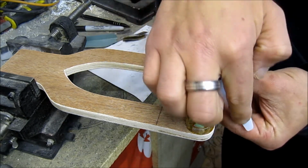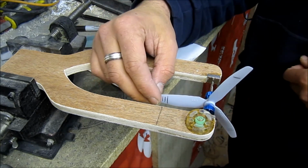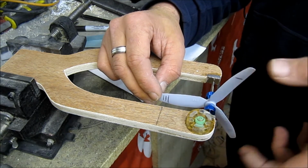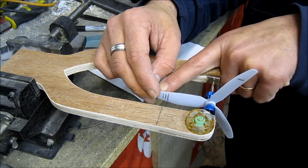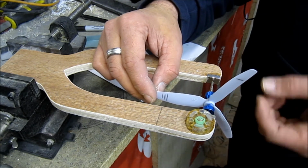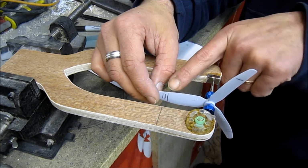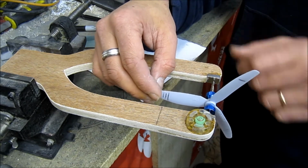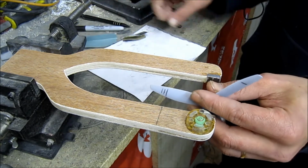Now, as long as my number 1 and number 2 are matching, I'm putting the number 3 blade horizontally, and here's where the physics kicks in. 2 blades, of course, are heavier than 1 blade, but 2 blades closer to the pivot point should be exactly the same weight as 1 blade further away from the pivot point. That's your seesaw when you were a little kid and you were light and some fat fecker wanted to have a swing with you. Okay, so my number 3 has to match this weight. As you can see, that was my heaviest blade, and this will be the most sanding involved, number 3. Okay, let's get it done.